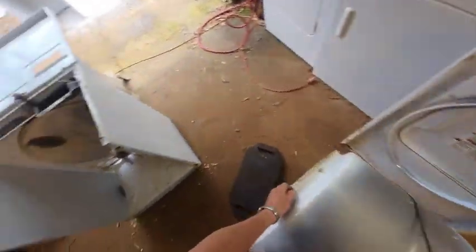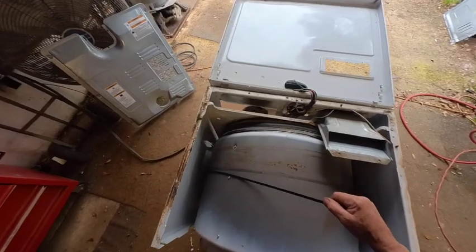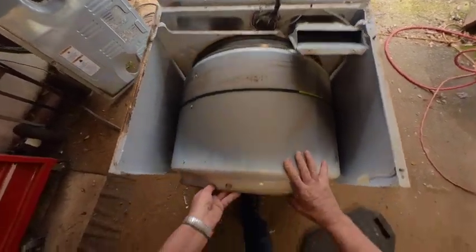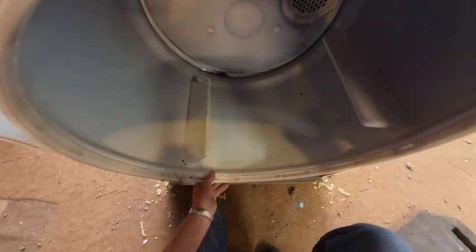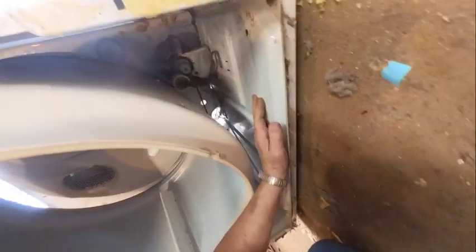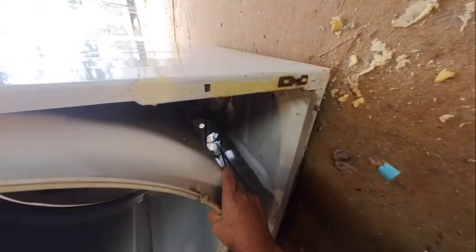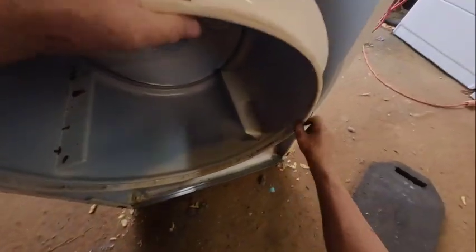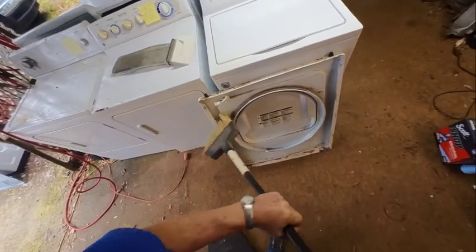Now I put my attention to putting the drum back in and getting it situated on the rollers. It had good seals on the rear, so I didn't change those. You kind of have to fish in underneath — the trick to getting a Whirlpool belt on is to thread it through the idler pulley arms and over the pulley on the motor. Then I'm looking inside and I see it's pretty dirty with black marks in there. I have to take a putty knife and clean all that out and repaint it.